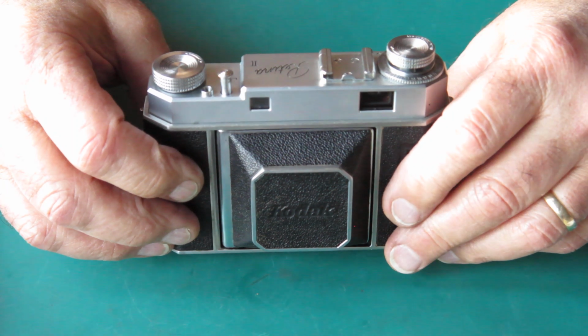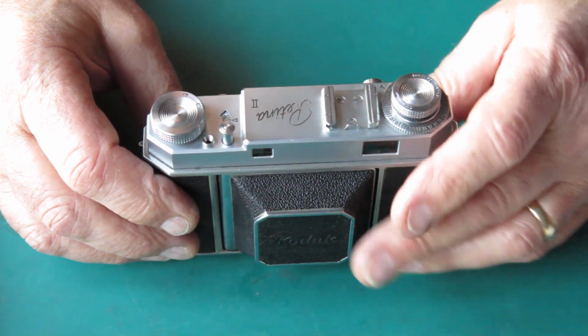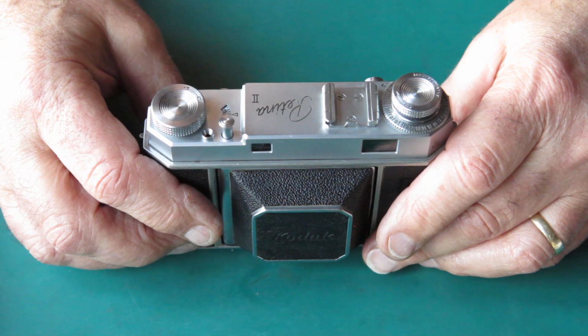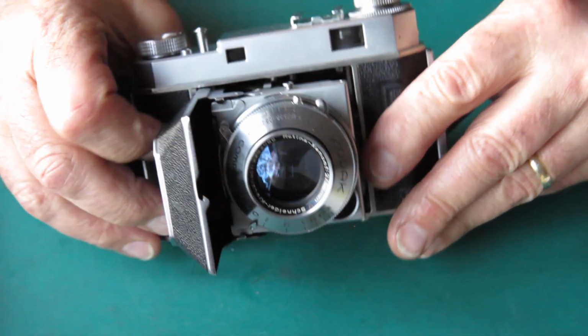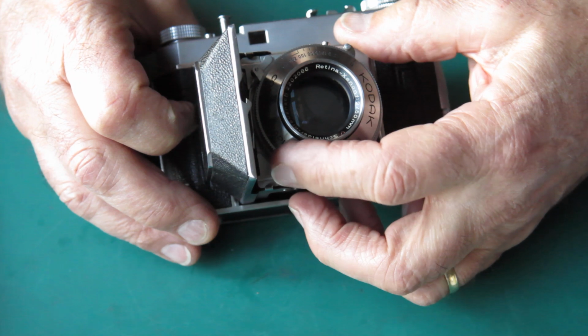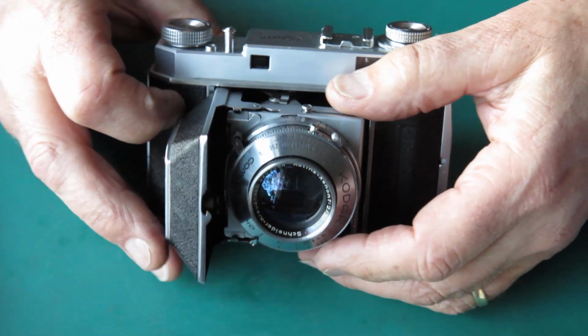Found a little puzzle in the way, and that was that screw on the back of the shutter that was holding the shutter from seating correctly, and so the focus could never have been quite correct, and there would always have been that annoying wobble. Anyway, that's gone. Everything else is good. The diaphragm, of course, that's all good now because that aperture was not good before. That could not be moved.